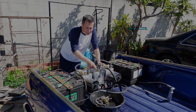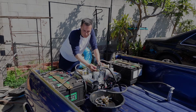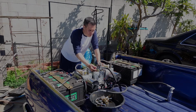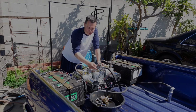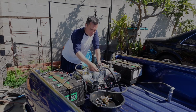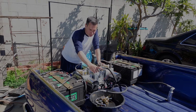This setup also has a smaller 3/8 inline check valve. I don't really like these. These are good for basic small setups, but if you start hopping or put any serious pressure on them, they do tend to fail. The pump that I'm putting in has a Parker 3/8 check valve, which is a lot more sturdy. You'll see it. It's a girthier piece.